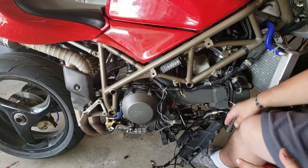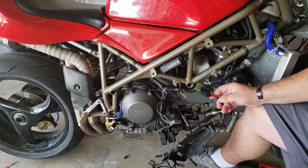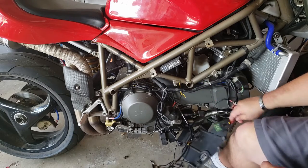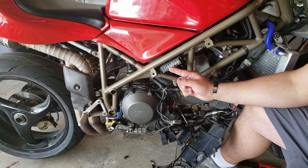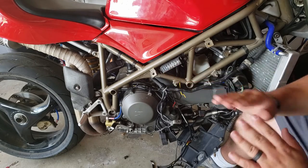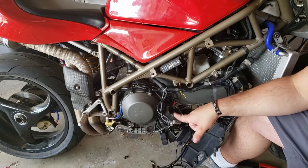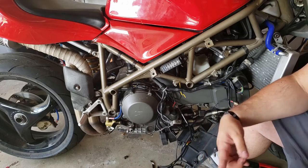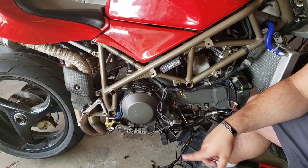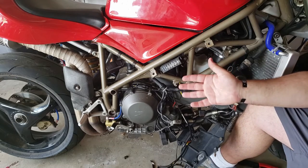That being said as well, this is one of the fuses here. This fuse, I checked it. It's good. There's continuity. And I checked the 3-amp voltage regulator fuse in here. Both are good, so it's not a fuse. We have continuity from ground to the wire that runs to the regulator, and we have continuity from everything else. But none of that matters.